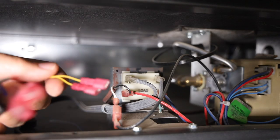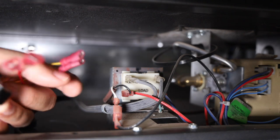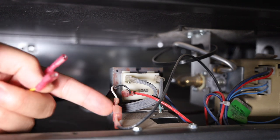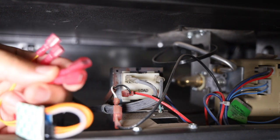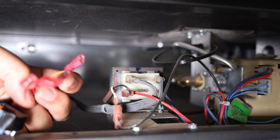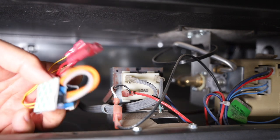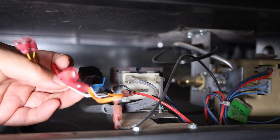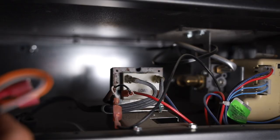This is actually going to be a pretty simple install. Essentially, all we're doing is unplugging these two wires that are coming from the switch. We're going to plug those two wires into the relay, and then plug the relay into the connections where we removed these wires. What makes this really easy is both of the wires on the relay switch are either male or female, so there's no wrong way to do this. After we plug this in, we're going to plug this whole thing into the smart outlet with the included AC adapter.